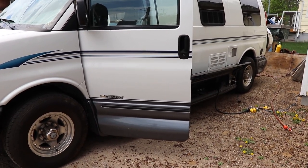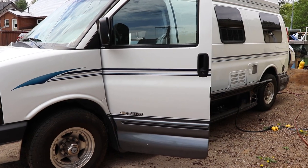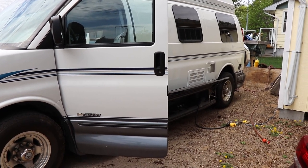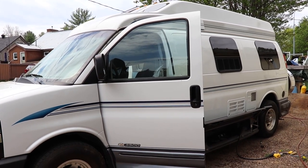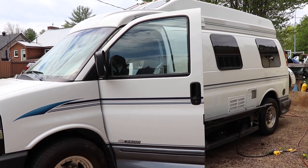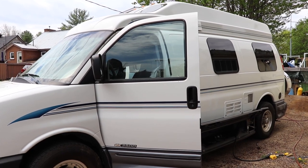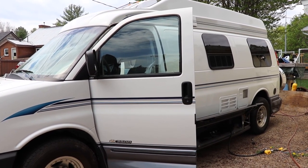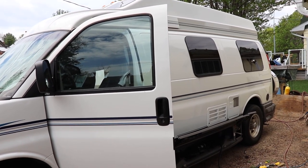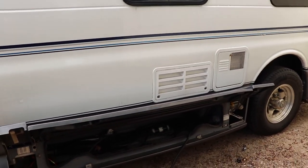Good day. Today we're going to look at sanitizing the water system on a Road Trek Popular 190. This is a 2004 model. Some of the other models may be a bit different. Not all of them have an interior water tank, so if yours does not have that, you're just going to save a bit of time. This job will probably take four to five hours. You need to let sanitizing take place for about three hours according to the manual, and you need to have a copy of the manual. I'll provide links in the description to get a copy specific to your vehicle. It is a potable water system, so if you make a mistake you could make yourself ill. So it's important to understand this before you start.